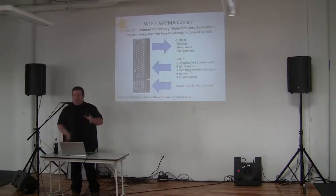If something is in the cabinet and you have no sound, check the 12V line. Usually that one's broken on the power supply, so it's 50 euros for a 25-euro new power supply. I can sell them.